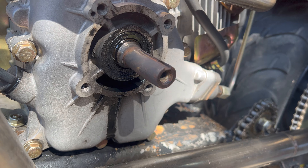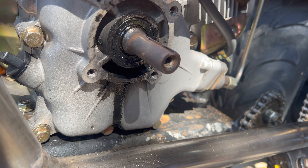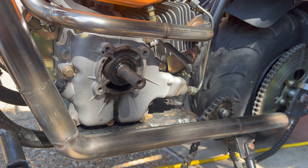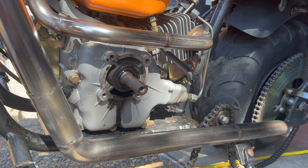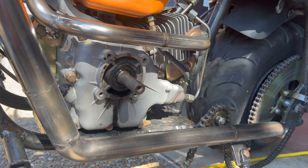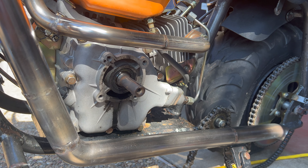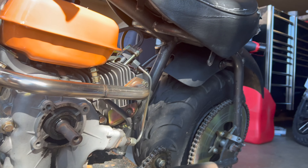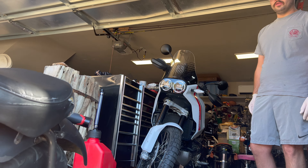So what you think about this seal, Chance? It's just got a little bit of a leak — just a slight one. I washed it before the last ride, so that's from one ride. How'd you end up getting it off? GM pulley remover set. I figured I had a pulley remover set. A clutch puller would have been more ideal, but it worked. I was worried something was going to get stuck since it wasn't made for doing this, but we got the job done.